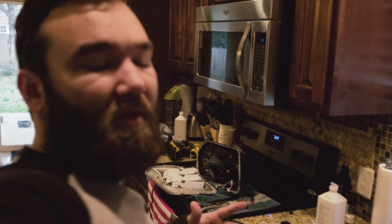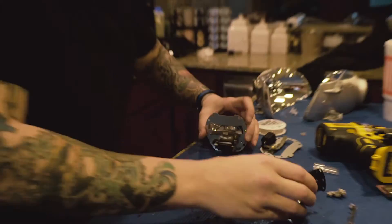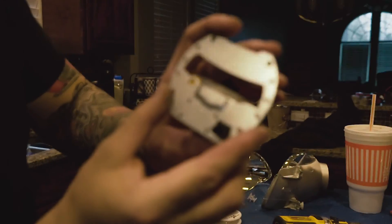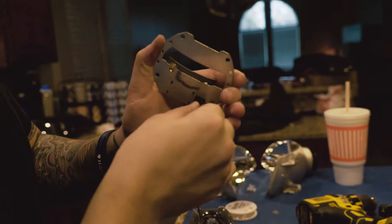We were having some trouble again — my driver side bright light wasn't working. Matt got everything fixed, wired up, and then as he was testing the bright light he noticed it still wasn't working. Seeing as he accepts nothing less than top-notch quality, he took it all back apart just to fix a prong that was bent and get my bright lights working. Right now we're disassembling the entire projector to swap the high beam solenoid — there's a broken prong in there. He just happened to have an extra one laying around, and you can see how two wires plug into it.